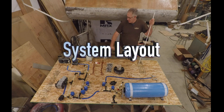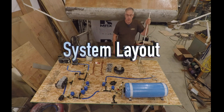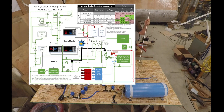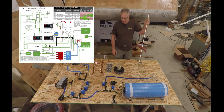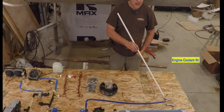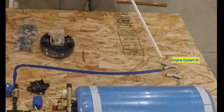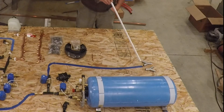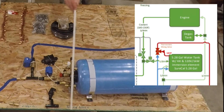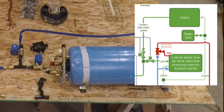The layout you see here on this table are all the pieces I'm going to be using to install my hydronic system. This layout is approximately similar to the layout on the schematic, so I'm going to go through each part and describe what the symbols on the schematic mean in real life. Starting over here on this side - this is where the engine heat will be collected. There are two branch connectors here that tap into the heater hoses that go to the heater core on the engine, and this is where the hot coolant is brought in. Three-quarter inch heater hose is represented by this blue line, and three-quarter inch return hose is represented by this white line.